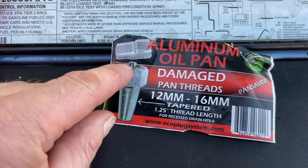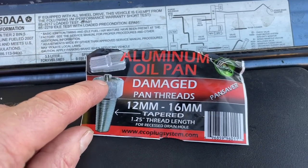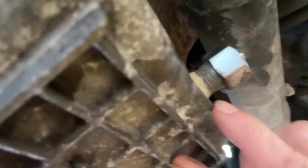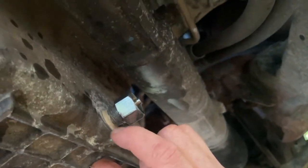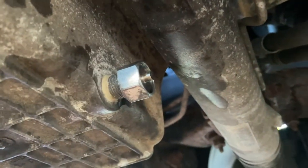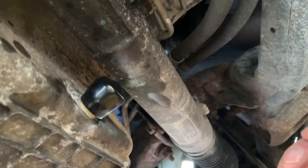This little piece is magnetic — I'll show you video clips of my oil change so you can see exactly how it drains. Here's the actual installed piece, as you can see, after three years. You use the excess epoxy to go around the thread just for extra connection. Here is your magnetic piece — you just pull this out and the oil drains right out. Clean it up, put it back on. It even comes with this rubber sleeve so after your oil change you just cover it to protect it.